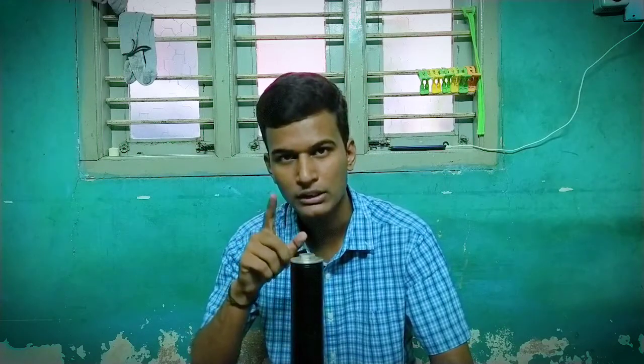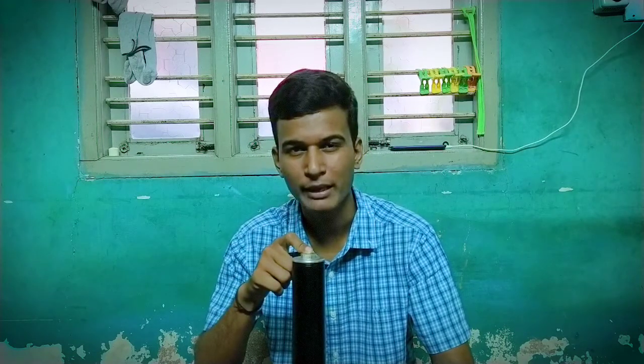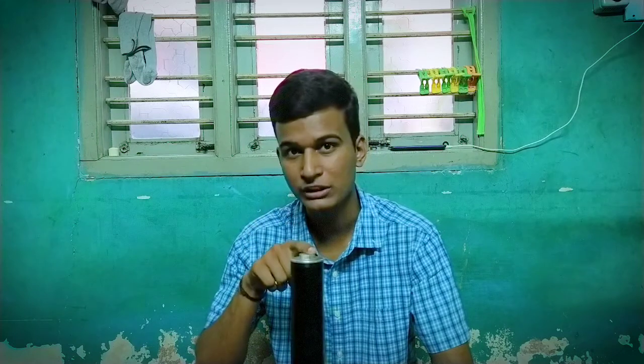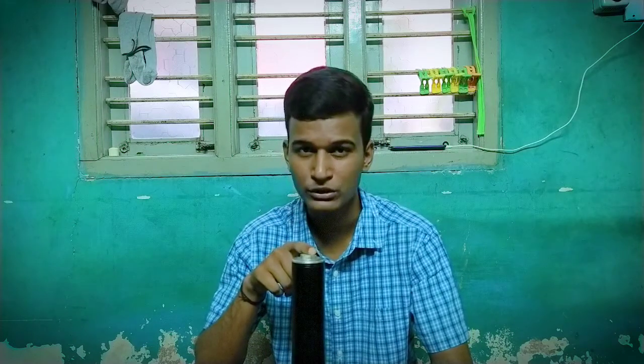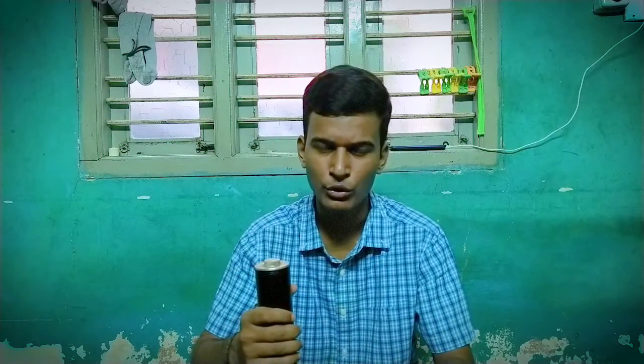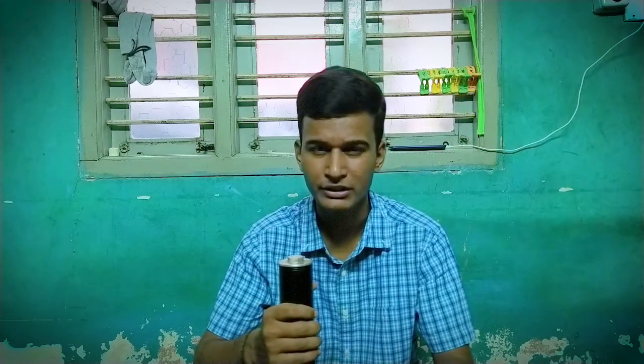In an upside down fork the cartridges, fluid, and damper are all at the top. So whenever you buy a middleweight or liter-class sports bike, the company offers adjustable USD forks — either manual or semi-active suspension. Both Showa and Ohlins offer manual as well as semi-active suspension options. Some people like the suspension soft, others like it hard for maximum feel when riding fast around corners or in a straight line.